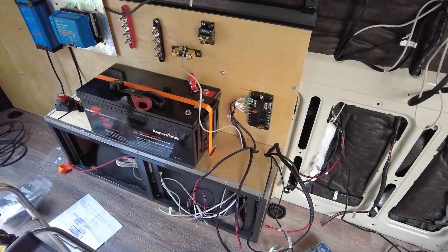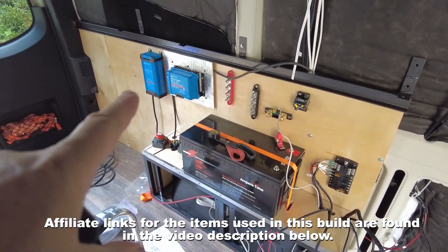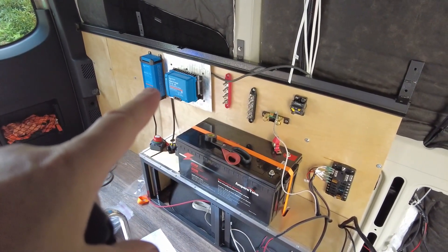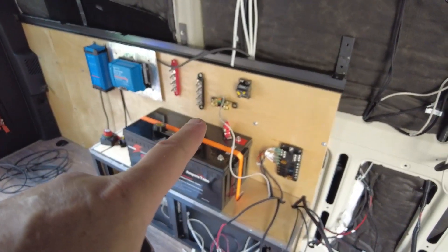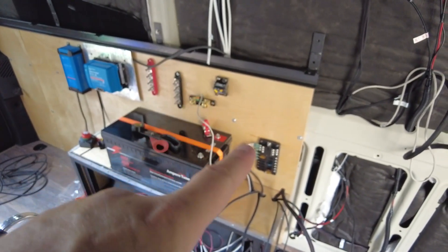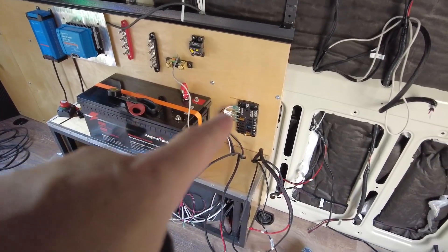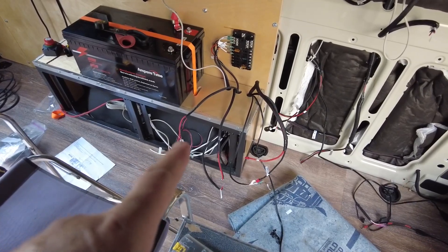Here's mid-install of the electrical system. Over here I've got my 110V mains charger. Here is the DC-to-DC charger, positive bus bar, negative bus bar, plus the shunt for the controller. This up here is going to be from the fuse box to the positive so I can fuse the whole fuse box. The fuse box is right there. All the leads are going down into this box — it's going to be kind of a rat's nest of wires but it'll all be hidden.